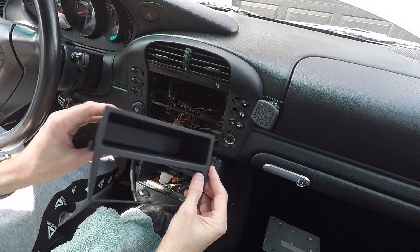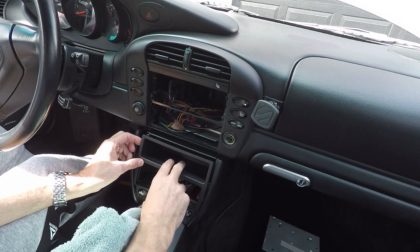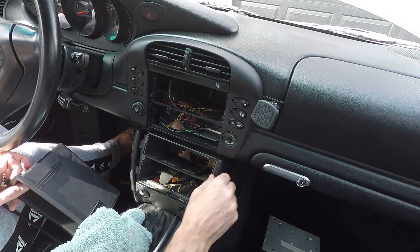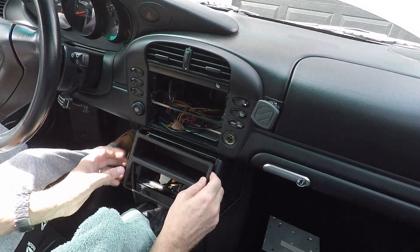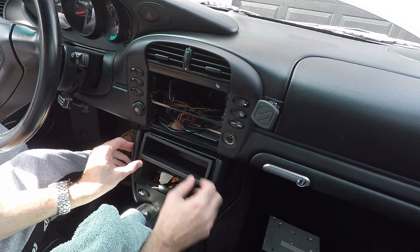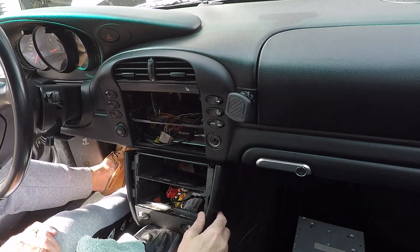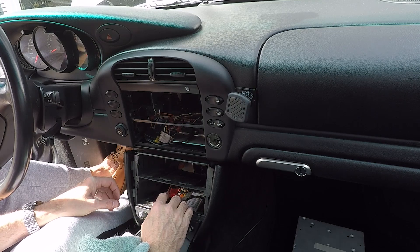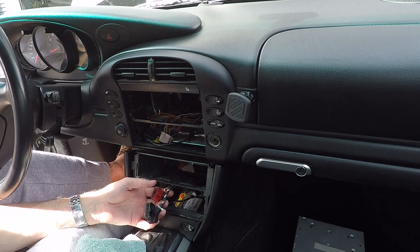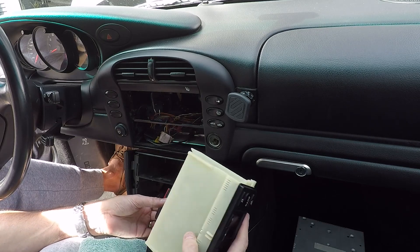Here's the piece from the Metra kit. It's going to go in like this — cubby up here, HVAC down here. These two pieces have to be removed because there are tabs that will go underneath. I've got these panels flared out so I can get the Metra trim in there after I get the HVAC control in. Let's put this in now.